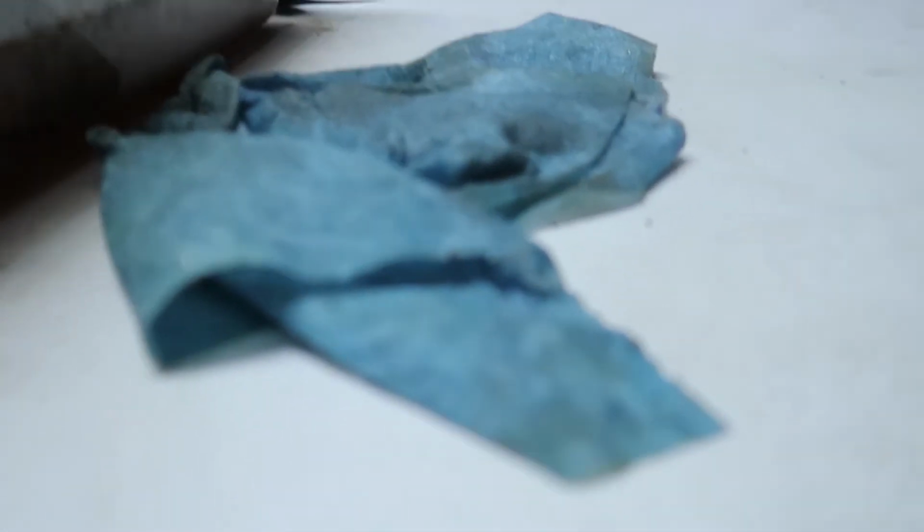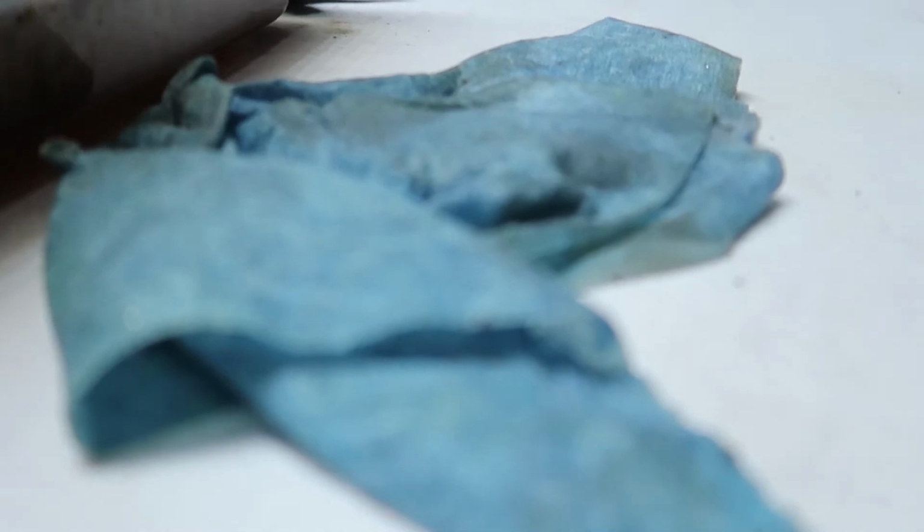Alright, so if you're ever in a position where you're going to be rebuilding an engine yourself, you got to be keen-eyed, especially if you're trying to reuse parts like, say, an oil cooler, because what happens if an engine grenades itself? All those shards of metal get sucked up into the oil pickup and go through the entire everything. Good case of when not to reuse parts.